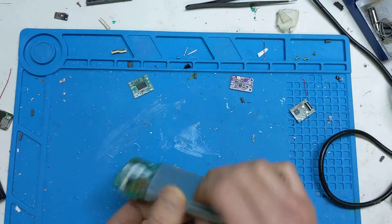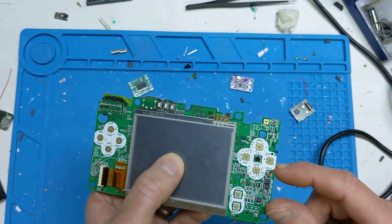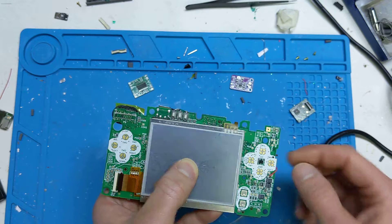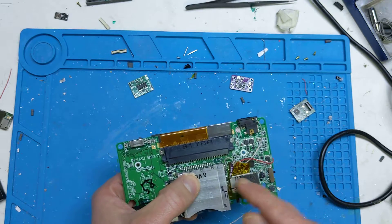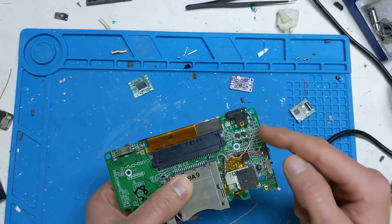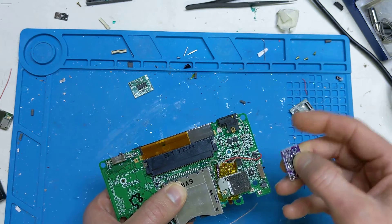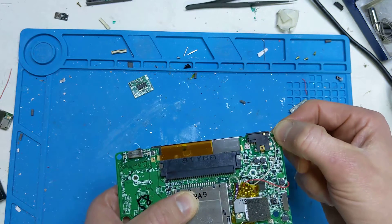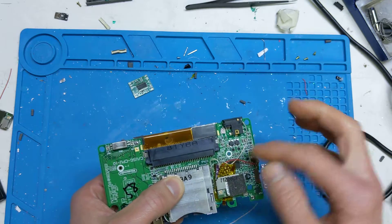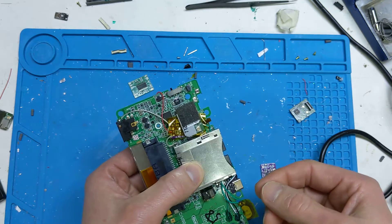What I did was I just wired 3.3V on the front — it's marked up — put the wire up around here, because there's a gap in the front faceplate from around here, wired it into the amp, took the ground from the ground shielding off here, because ground is ground. Took the audio minus off the bottom here, and then the audio plus is off the alternative wiring on that chip. It's all kind of localised, and then I just run the wires for the switch speaker under the DS slot.